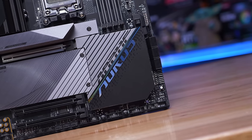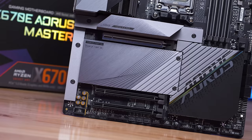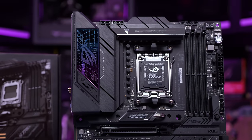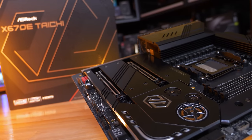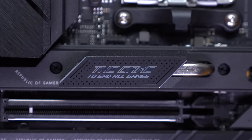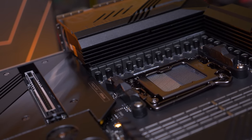The least impressive of the other three $500 options is the X670E Aorus Master at $500 — it's really not a significant upgrade over the Aorus Elite AX despite costing over $70 more. It is an X670 Extreme board so you get PCIe 5.0 for the primary PCIe slot and a second PCIe 5.0 M.2 slot, and the VRM has been upgraded to 105A power stages from the 60A models on the Elite, but that benefits very few users. A bigger problem is that for the same price, the ASUS ROG Strix X670E-E Gaming and ASRock X670E Tai Chi are better equipped: both wire their primary and secondary PCIe x16 slots to the CPU for PCIe 5.0 bandwidth. The E Gaming is the most affordable X670E board with three PCIe 5.0-enabled M.2 slots, while the Tai Chi supports USB 4 and eight SATA ports. Picking between the two is very difficult — both are excellent boards at $500.